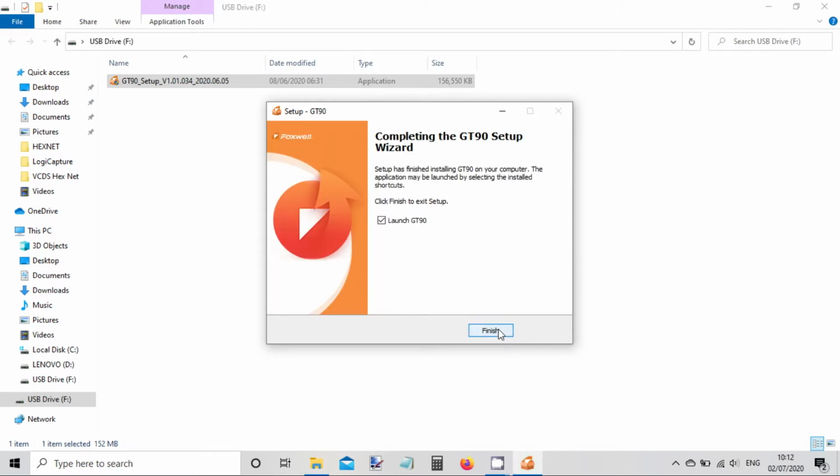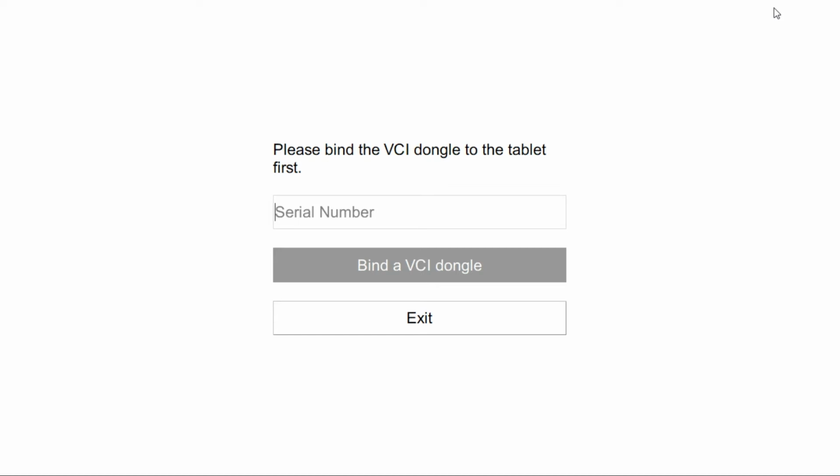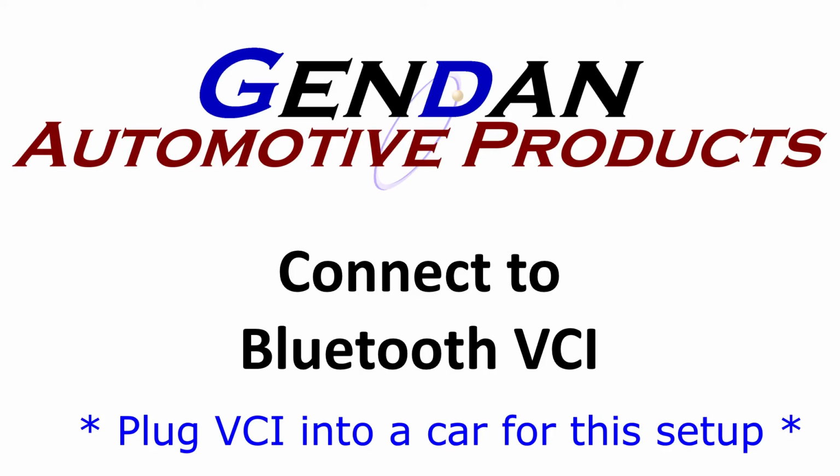Okay, and then we can click on finish. That will then open up the Foxwell diagnostic software. So the first thing the software is asking for is for us to bind a VCI dongle to the package. Now to do this, we need to set up the Bluetooth connection between the laptop and the VCI dongle. So we're now going to guide you through that set of instructions.